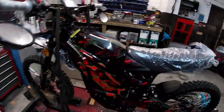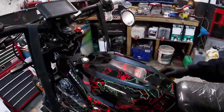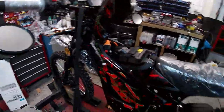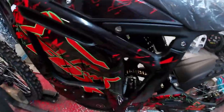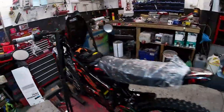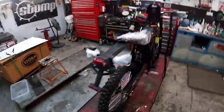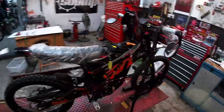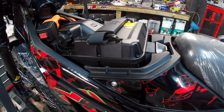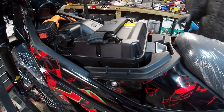Hopefully this makes it a little bit easier for you guys doing your own bikes. Basically what you've got to do is pop the battery up. You've got to take these three bolts out, but before you do that you need to take the battery out and unplug the rear light. I'm just going to set the camera up a little bit better and show you up close.